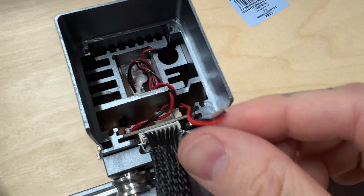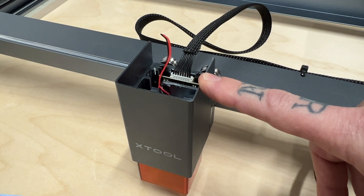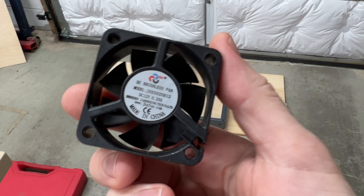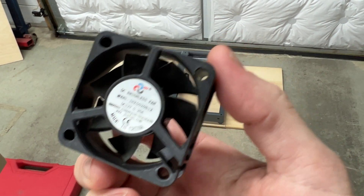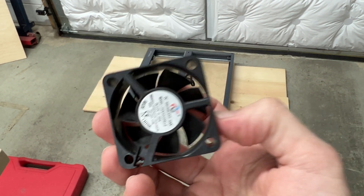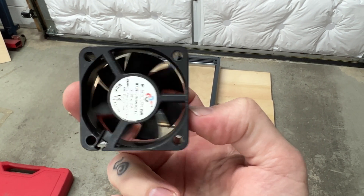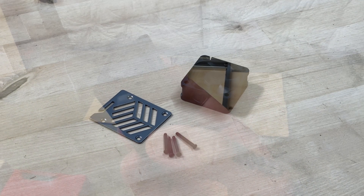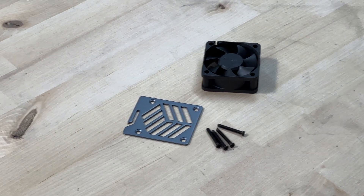This is not a wireless fan — it's a 50 millimeter 12 volt fan, and it's no longer attached. You can see the fan wires are just awfully short. So when I tried to pull them out of the way, they just came right off the fan, and I'm not even going to bother trying to fix that fan. I looked up this part number and really wasn't finding anything, but it doesn't matter — it's louder than I cared for anyway. And it's a 50 by 20 millimeter fan, so I can't buy a Noctua that directly replaces it. All the fans I can get locally are like 50 by 10 millimeter, so that doesn't make sense anyway.